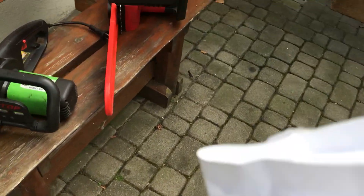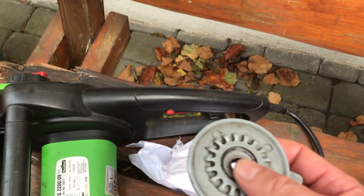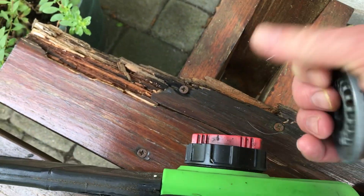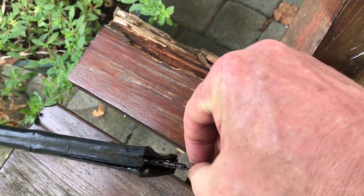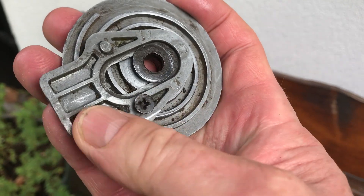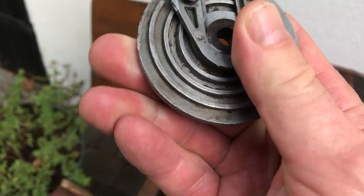Yeah, I have it — that's the old one there. I've put in a broken Florabest chain adjuster. What you're looking at is a mechanical piece that obviously takes a lot of brunt — a lot of vibration. This lives underneath the cover, inside the saw, inside that green housing here. You can do the adjustment just by finger tightening. The black is the adjustment for the chain tension, and the red is the lock. What was happening was — you can see there's a worm gear there — as you turn the black it tightens the chain, but you can see it's loose. So that had to be replaced.